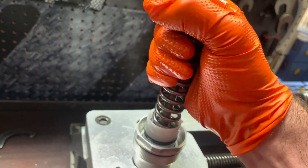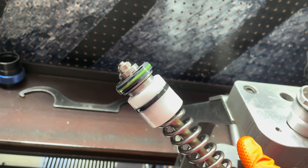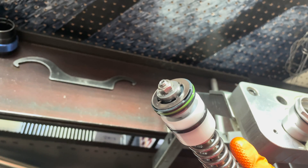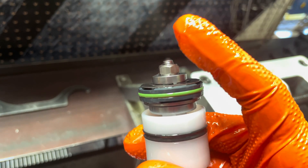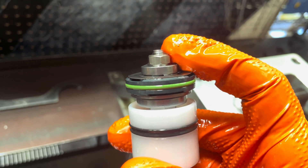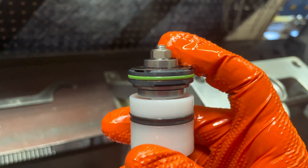We got it out. Use two hands — don't do what I was doing. Now we have our compression assembly. The install on this is identical to our 2021 and 2022 models, so please reference that original video that we have. One takeaway is we are going to remove this spacer from underneath this nut — keep that spacer handy because we are going to reuse it on your mid valve assembly. We're going to use this spacer as spacing so that way when you put the mid valve assembly on and go to put the nut back on, everything is going to line up just perfect.